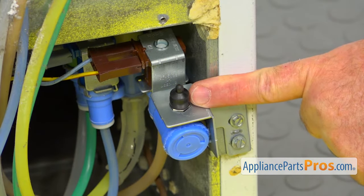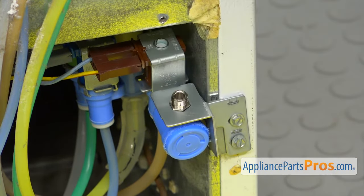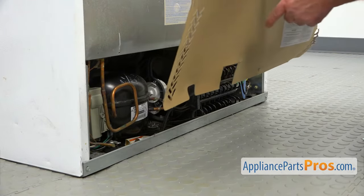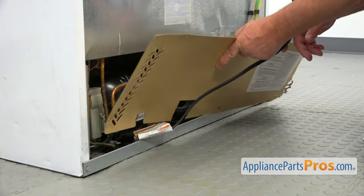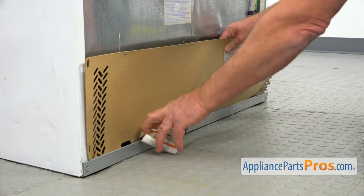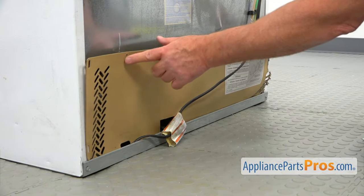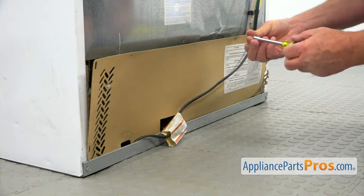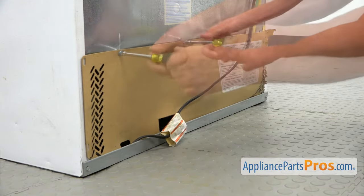This protective cap should be removed when you're ready to install the inlet hose — just pull it off. Now I feel pretty safe and we can remove the towel. I'm going to install the rear access panel by pulling out the power cord, inserting the panel at the bottom with the power cord in the cutout, matching the holes, and securing it with the four quarter-inch screws using the quarter-inch nut driver.